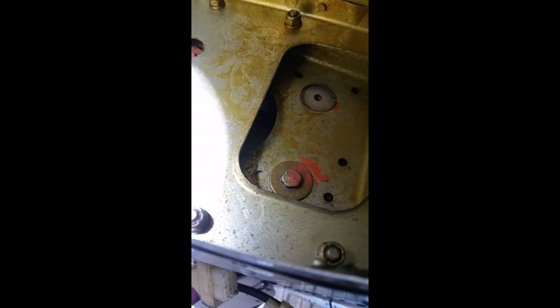The old servo is held in place by four bolts — I've taken out the top one, there's two there and two over there. They're three-eighths inch. I also have to remove the servo mounting bracket in the right wing, which has screws and nuts. I've got to go in one inspection hole for the screw head, and the nuts are over here — they're fiber nuts. The easiest thing is to put a needle nose channel lock on those so you don't have to worry about holding them.